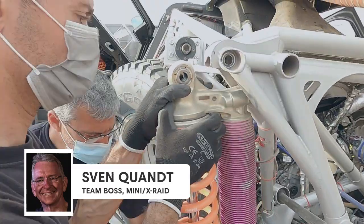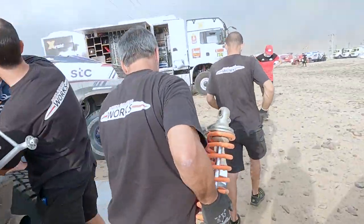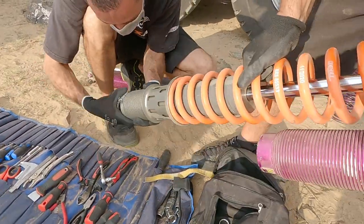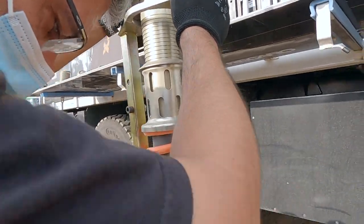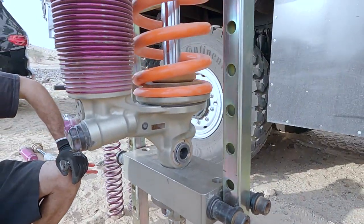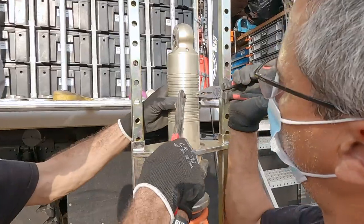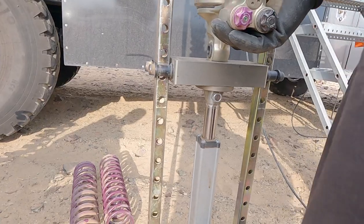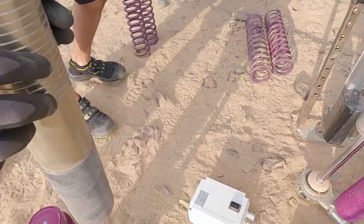This is actually adjusting the geometry first. Now they take the shock out. What is done is to take the adjustment off so that you can take the spring off. Now it must go to the spring press, as you can see, and the spring press is needed to take the spring off. There's a ring which fixes it, so now you lift up. That's a safety ring — the safety ring has to be taken off. Take the shock out. Now you can take the spring off.